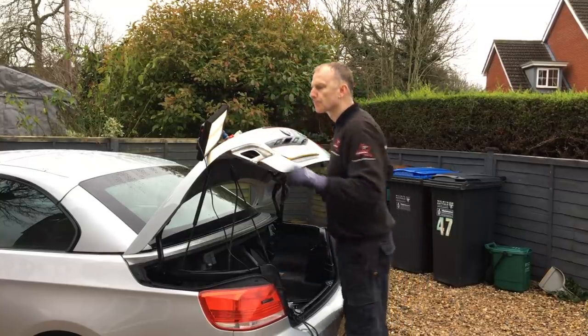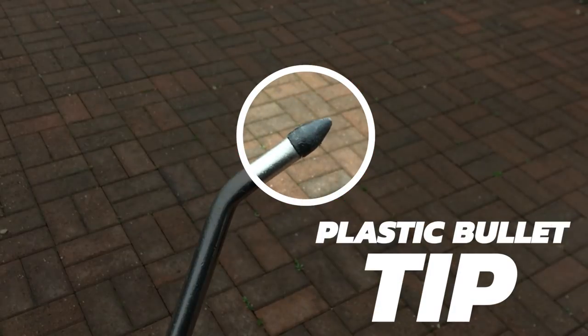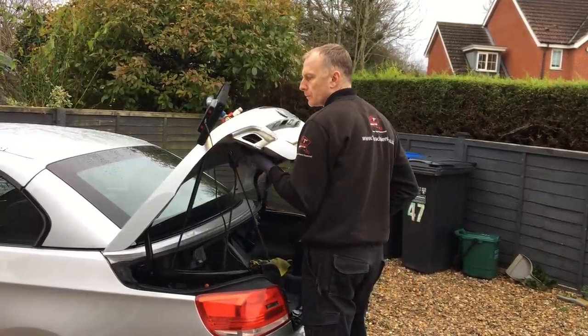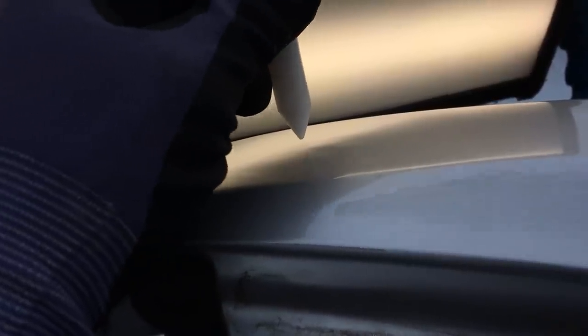This low section on the left has lifted up nicely. I'll come back later to fine-tune it, but now I need to work on the other two horizontal creases. The choice of tip to push these up will be my plastic bullet — when pushing up tight sections of metal the paint can crack very easily, so heat is very important. I take my time to ensure I'm right in the middle of the crease before committing to the push, otherwise I will add more pressure making it harder to remove. I then use a Delrin knockdown — a harder material better for tapping down harder sections of metal. I'm really pleased with the progress so far.